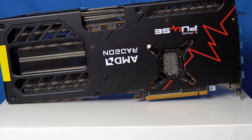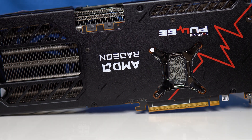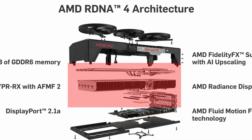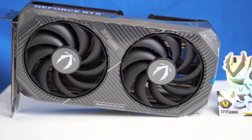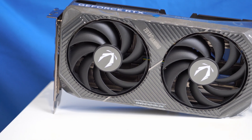So let's start with the main issue — the GPU fans themselves. Are they intake or exhaust? Well, they are intake. Your graphics card is made up of the GPU die, which gets very hot, just like a CPU gets very hot. So there's a big heatsink over it to help cool it. Just like your CPU heatsink with an air cooler needs fans to cool it, your GPU heatsink needs the same thing. That's why graphics cards often have one, two, or three fans along it to bring in cool air as an intake to cool that heatsink.